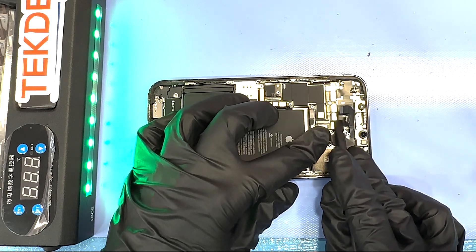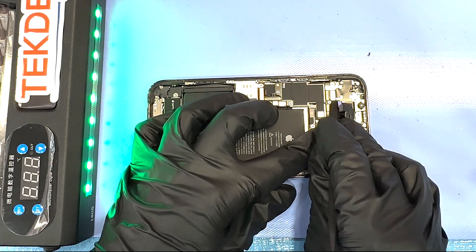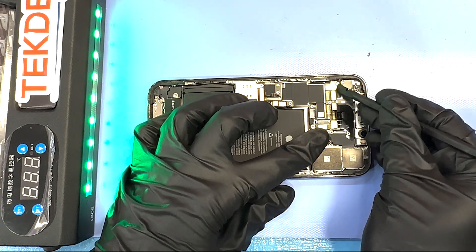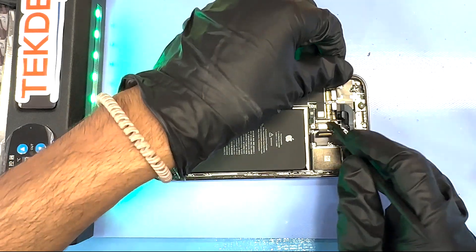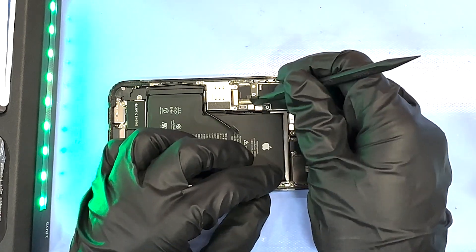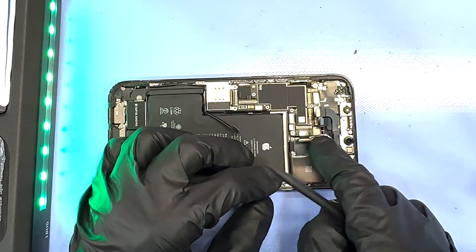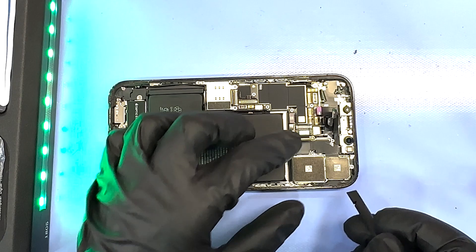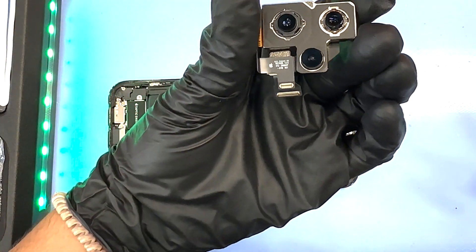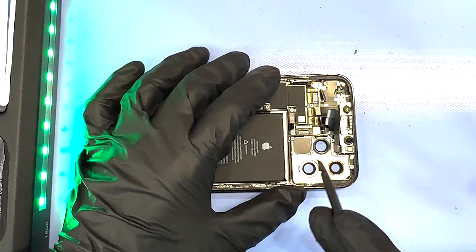It's definitely important to be mindful at this stage, as there are some mini ribbon cables underneath the flex cables. A good step here is to be safe — disconnect all of the flex cables you can see connected to the sandwich board. That should be the last ribbon cable of the rear back camera. This phone also has a space within the rear camera for a LiDAR scanner for AR augmented reality. This is one of the first phones to have this — I believe Apple first introduced it with the iPhone 12 Pro — allowing for scanning environments and creating an AR experience.